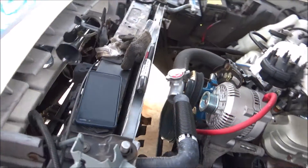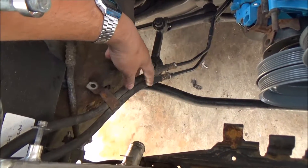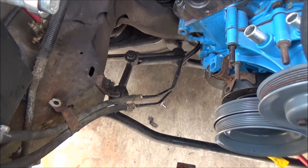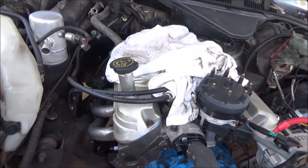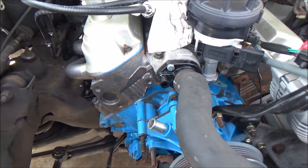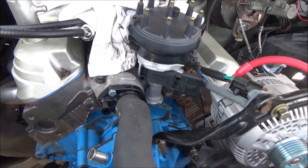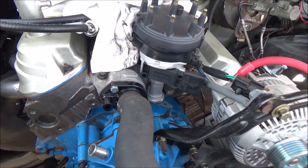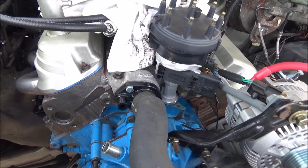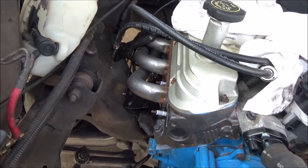I may need to go with an aftermarket transmission cooler. The good thing is you just splice the lines and route them to mount somewhere lower. I still need to change some bolts and swap in ARP bolts. I already poured oil in — went with Royal Purple break-in oil just to be safe so everything breaks in properly.